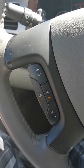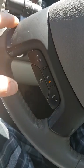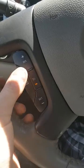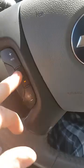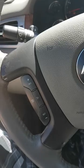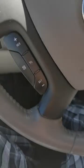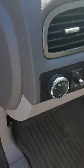2008 Silverado. With this vehicle I've had issues with my cruise control — this light would be on, and no matter what buttons you press and in what combination, no matter how hard you pressed them, the cruise control would not engage. I looked it up, did some research, and it's a common problem for the brake control module to go out on these things. It's very common for the 2007 to 2013 body style.